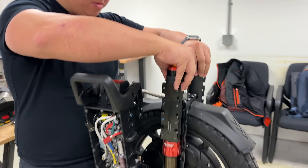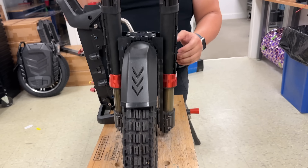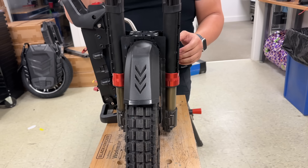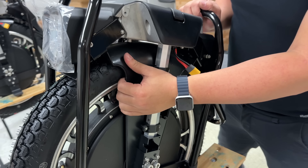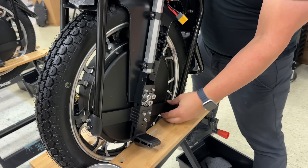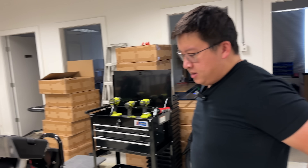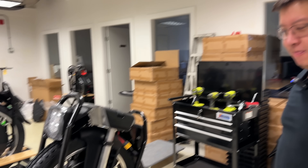The suspension posts are mounted to the motor axle, but they're using the battery pack, the controller, and the other battery pack to create that U-frame, so you have the structural rigidity. If you look at the Abrams over here as a contrast — similar concept — they have this plastic U in the middle for the mud guard, but all the structural rigidity comes from these roll bars as well as structural elements down here. Anyone that's ridden the Abrams a lot will realize it gets some flex over time — but it is what it is.